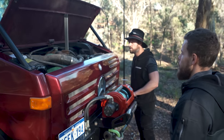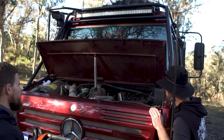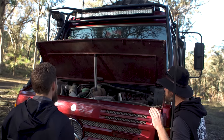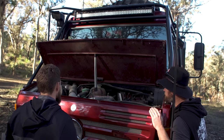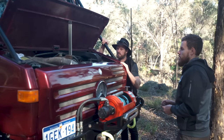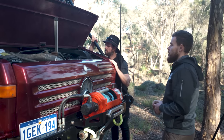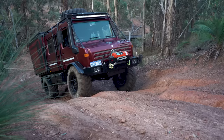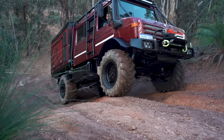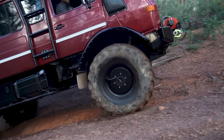It's a 5.7 liter inline straight six, just a big turbo diesel. It's called a 366A. These trucks this year came with a 352A, and the 366 is just a bit of a newer engine, with a slightly different modified stroke, I think, pretty similar. Just when we were building this whole truck up, we weren't really sure of the history on the older engine, and so it got swapped out for a newer one.